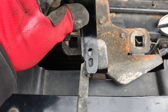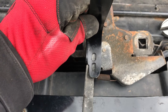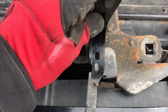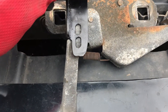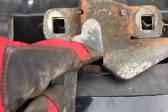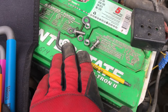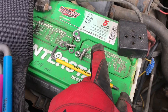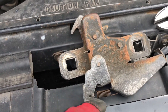As far as depth, you can see how it kind of thins out towards the bottom and meets in that little nook — that's roughly where you've got to be. If you lift it up anymore you're down to one bolt and that's not going to work. So there's a clear and confined space for this. Grab a sharpie, put two dots for where you'd like to drill your holes, then drill them. For this job you're going to need a wrench and a 5/32 L-key to hold the back, at least as the kit comes from A&M Fab Performance.